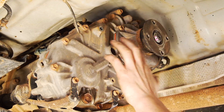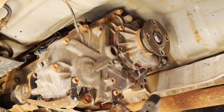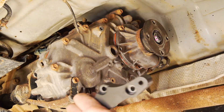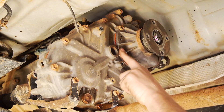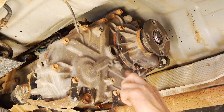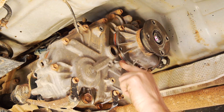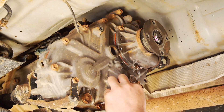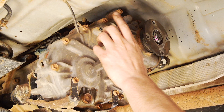It's a good idea to get a wire brush and give it a bit of a clean off, especially in the spigot locating area — want to make sure that's clean with no debris in there. A bit of Scotch-Brite works really well also. Because if you've got like 0.1mm of stuff on here, it's going to be running the disc out by 0.1mm. So the cleaner you can get this, the more true the disc is going to be. A lot of these models have these threads clogged up with dirt and crap — so check that.